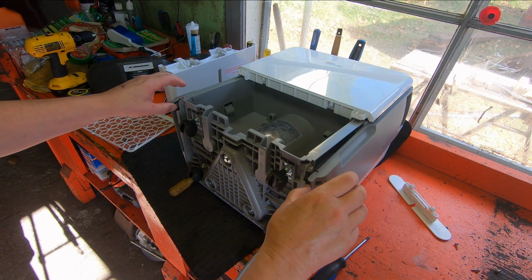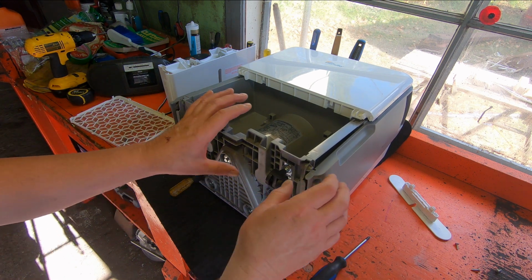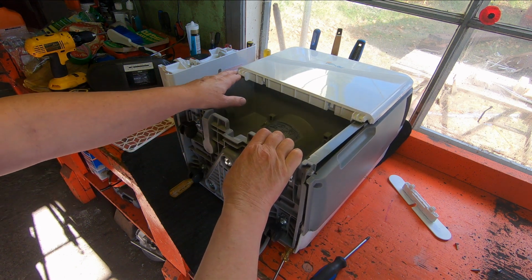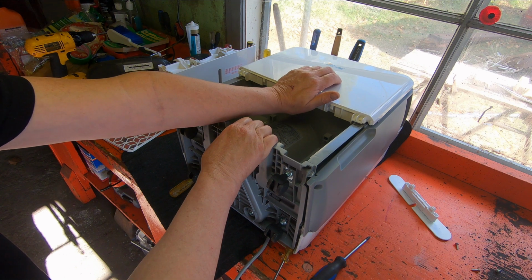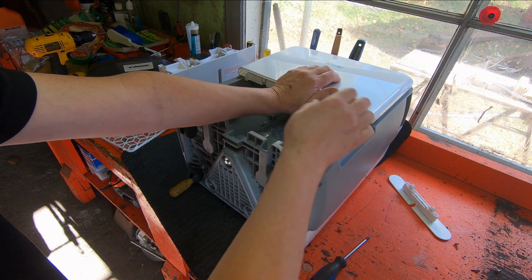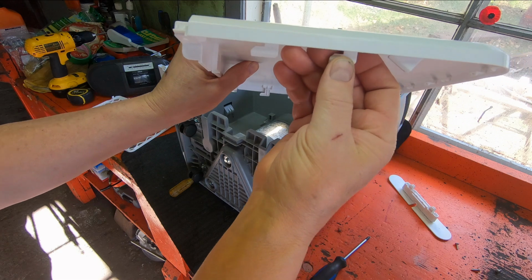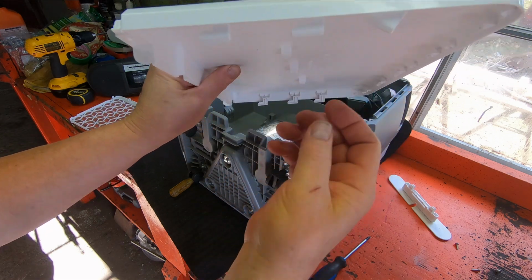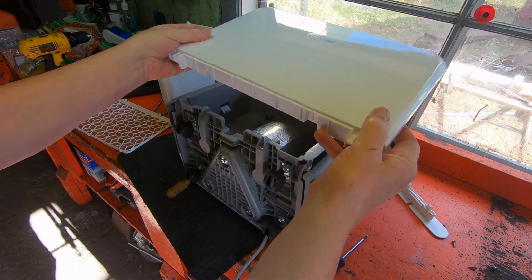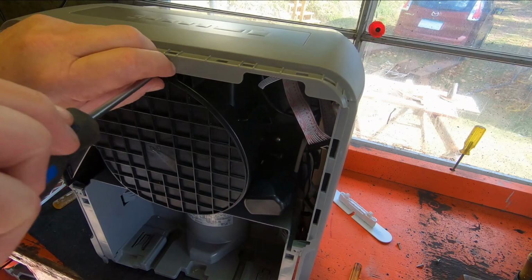Okay, so I've been going around the case trying to open it up here. All the fasteners are out of it. I've been trying to pull this out of it, and there's some screws that are in this white piece here, and what I did was I pushed on it, because I didn't want to pry it here. I figured there was some type of a clip in there, and when I pushed on that it released these hooks that are sideways here. Okay, see that? So if that's how that comes out, you can take out these two screws and then pop that towards the top. Oh, there's a screw right here. Look at that. There's one right there.